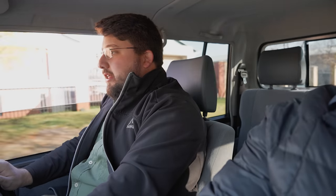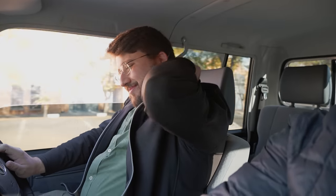How's the pedal feel? It's much better after we put the braided brake hoses. Yeah, I thought it would be. Remember, if the dual diaphragm booster is putting more pressure, and those little hoses are only designed to take so much, you might be stretching it beyond what they actually want. But I think it actually feels really nice as a passenger as well. It feels smooth and stable, but it can really stop if it wants to. So it's actually a fantastic upgrade.